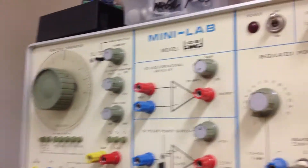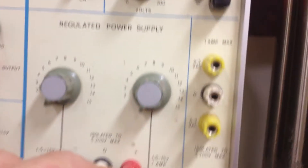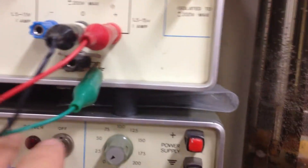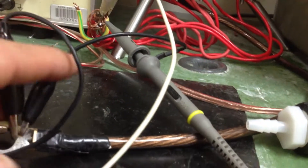This is my signal generator — I'm powering it by a regulated DC supply on this one. It's an independent isolated supply, so I've got the isolated earth on it, but the cell is earthed separately both through the earth here and through the scope. With the scope shot, it doesn't matter if I earthed it or not, but I did it just for the sake of it.